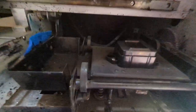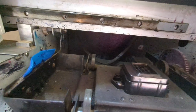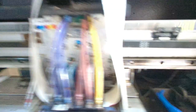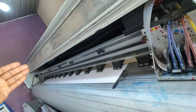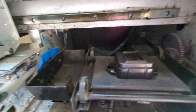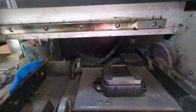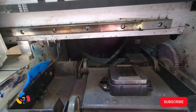If I take this aside, this is the cap. The cap performs one important function: it is where your printer head sits when it's done printing. The cap is instrumental to your printing because it serves the function of suction, and it ensures that your printer head is properly covered so that air does not block it.